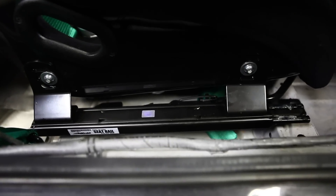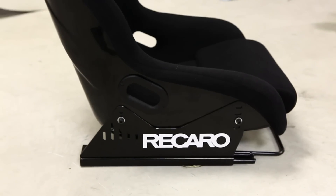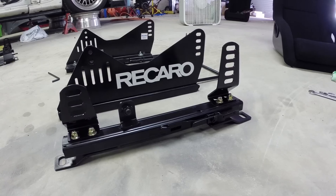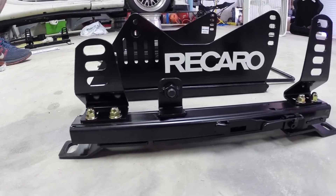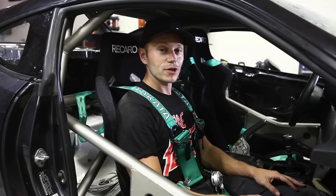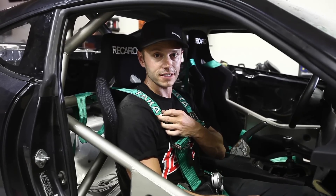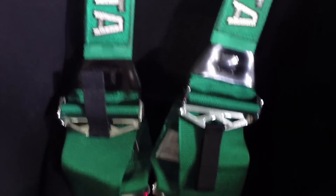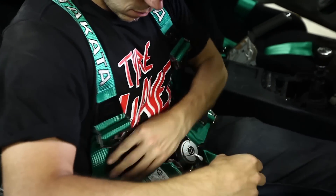As you can see, the seating position on the passenger side is much lower thanks to the Buddy Club seat rails mounted to the stock seating position — that's what makes these rails so convenient. They bolt up with zero modification and have plenty of adjustment. The Recaro seat rails they sent us are FIA approved, so for a full-blown race car they're the way to go. However, for a street car or in our case a Targa car where FIA approval isn't required, the Buddy Club rails are a perfect, affordable option. We've also installed these Takata six-point race harnesses featuring a two-inch shoulder strap for HANS devices. Where Takata excels is their webbing construction — it uses only polyester, which doesn't absorb moisture, ensuring the performance of the belts is always consistent.